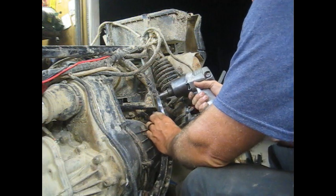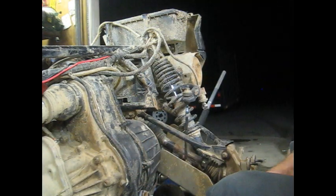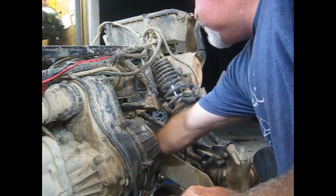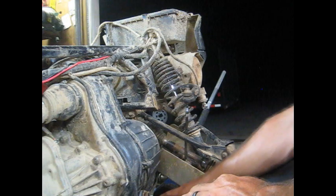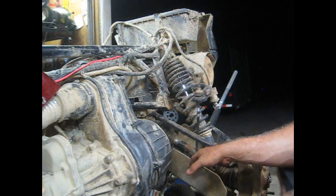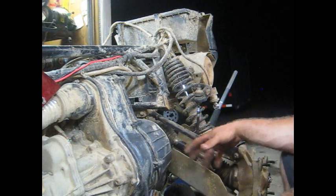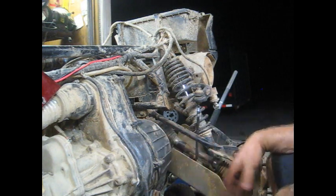Got this last frame bolt out - these are 15mm - which allows you to get the belt cover off; otherwise you can't get it out of the frame without pulling the rear end out. There are some bolts on the very bottom of the belt cover that aren't the easiest to get to. I might pull this half skid plate off and also the boot protector, because there's a bolt back there you can't get to.